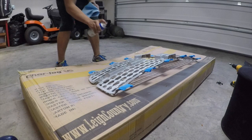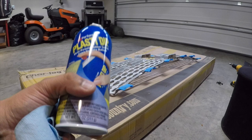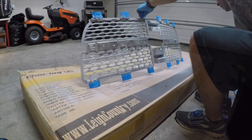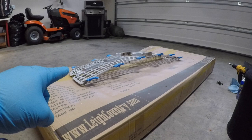All right, time for the first coat. Let it dry out for 10 to 15 minutes and then come back for the second coat. I'm probably going to shoot for at least four coats, but probably end up doing five, maybe even six. I waited 15 minutes to do the second coat. The thing about this grill is that you're really going to have to paint at different angles — shooting up, then straight on, then shooting down — in order to get within all those little crevices.